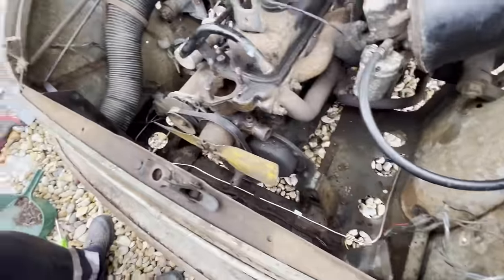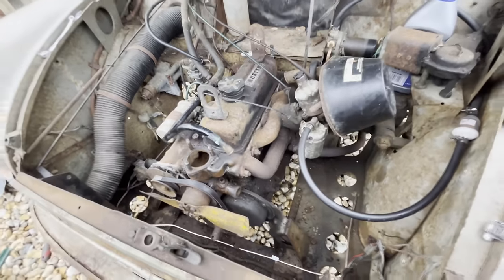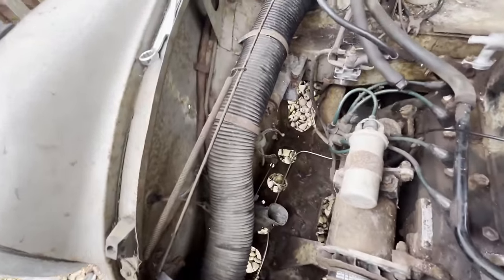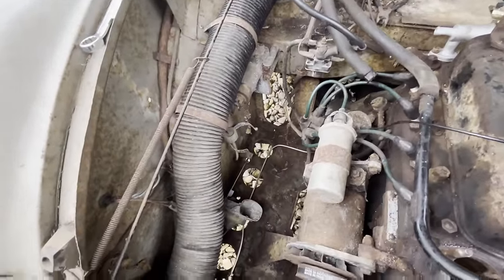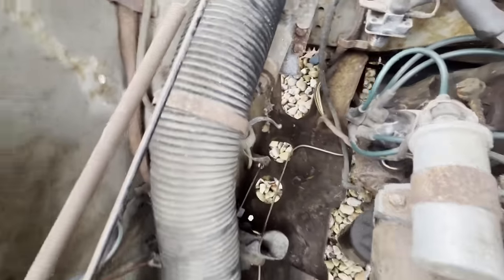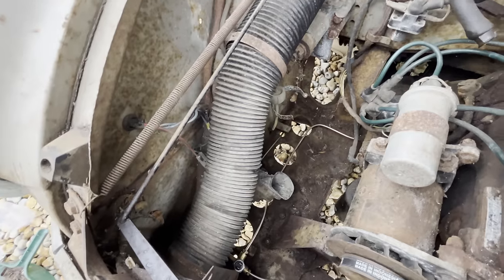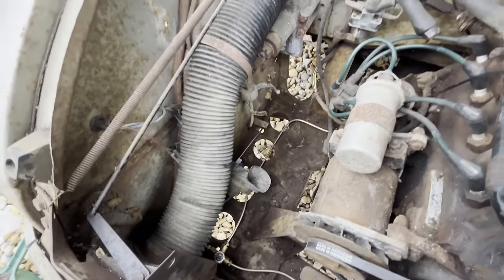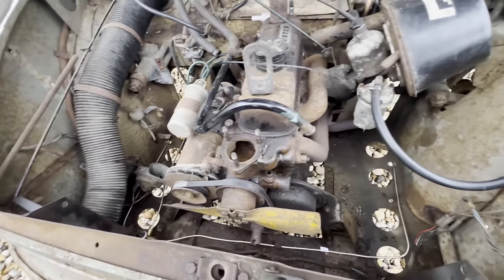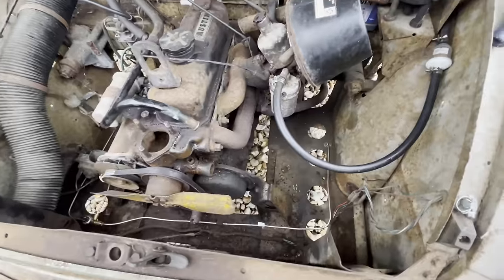Front to back now, my brother took the radiator out as you've probably seen, putting the new heater valve on. The next thing we need to bleed it. That is the problem I have found with these pre-made hoses - they are slightly too long or slightly too short. Luckily it has all worked. But this one, for example, coming up from the master cylinder, I've had to route it slightly differently just to use up some of the pipe because it's just way too long. But it's fine, it'll work and it's not going to hinder what we're trying to achieve. That is the Achilles heel of being lazy and getting someone else to do your brake pipes.